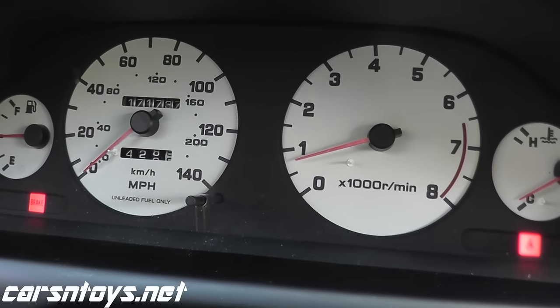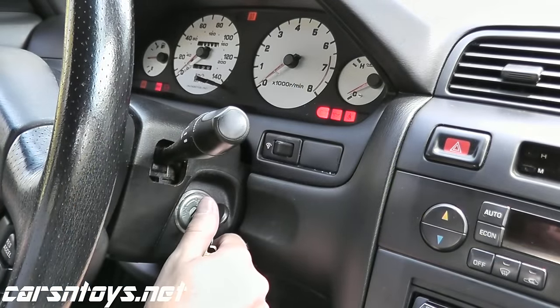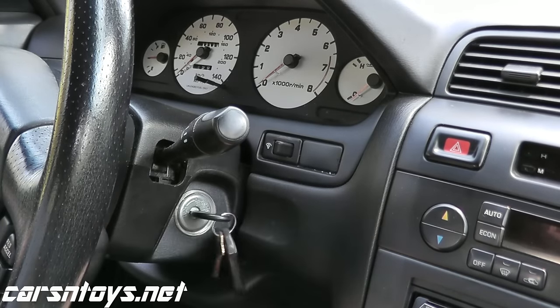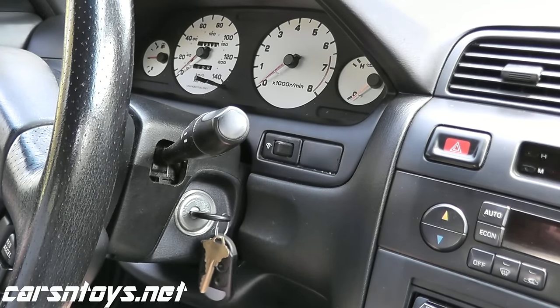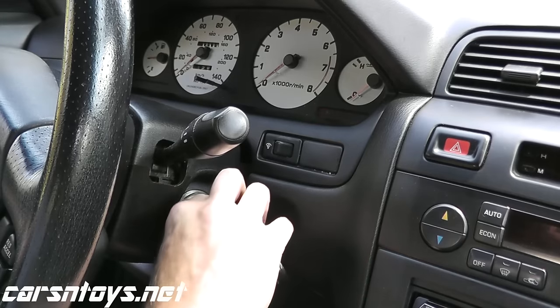As you can see, this is the perfect idle speed for this vehicle. Not a terrible job. Now the last step is you may need to reset something called the idle position memory. Usually you need a sophisticated scan tool to do that. However, on this specific vehicle, if you turn on the ignition key, then turn it off, wait 5 seconds, and repeat that process 20 times, it resets the position memory — no scan tool required.